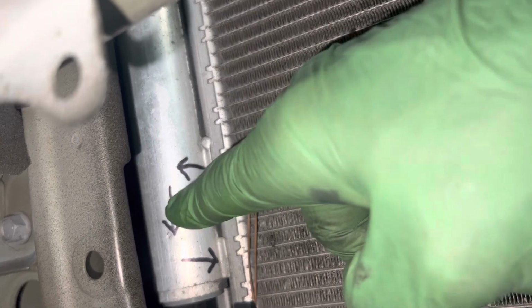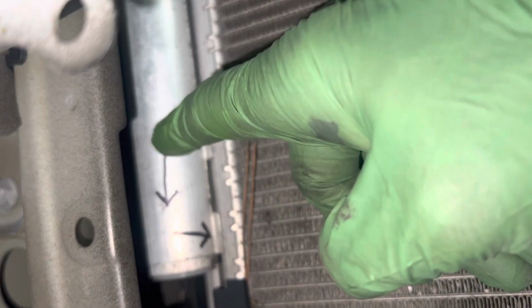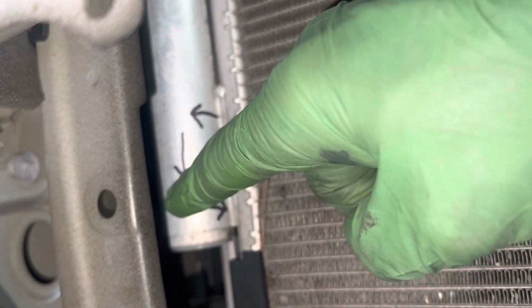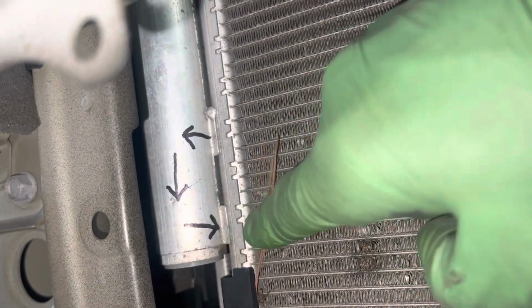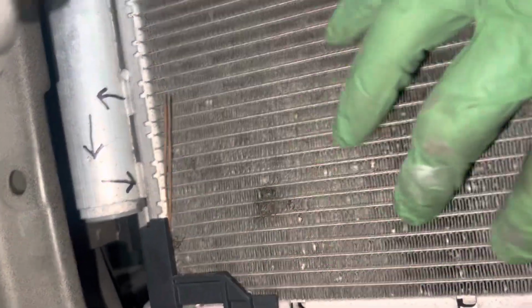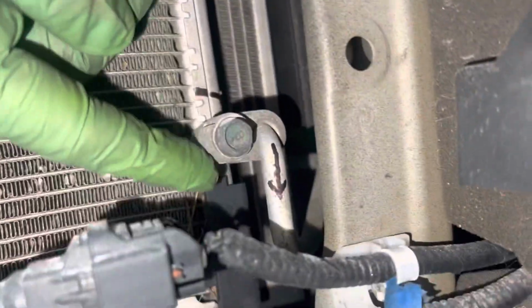Then down inside here, there's a little screen and a hole. And then the liquid refrigerant that's mixed with oil falls to the very bottom right here. And then from there, the refrigerant passage comes into here, and it'll be just these bottom tubes right here that will be all liquid. And it passes in this direction, going over here. And this is where it comes out.